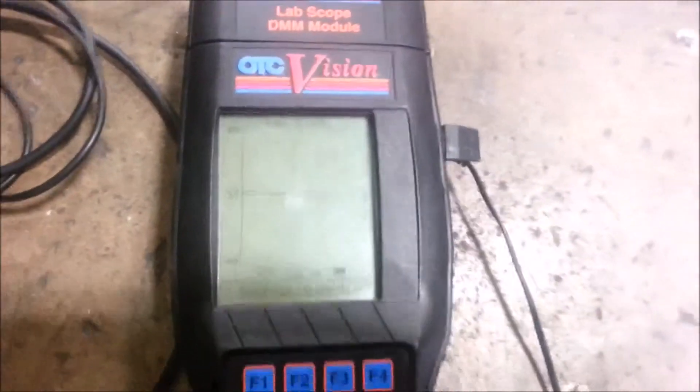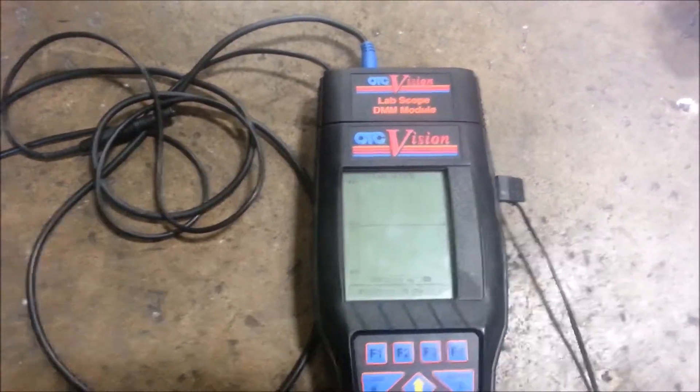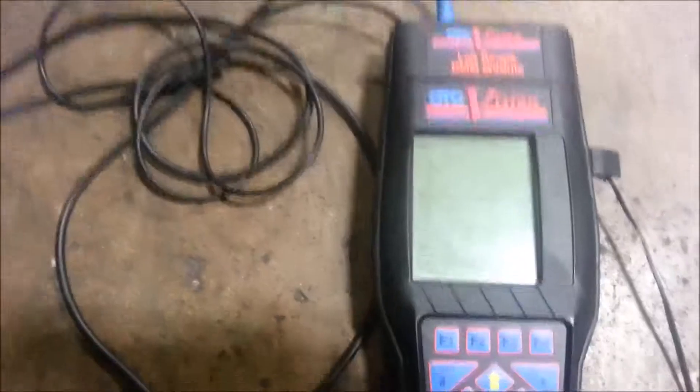But as you can see, there are no flat spots — the wavelength is actually clean. If you happen to have one of these scopes in your shop, they're right around five thousand dollars, but it makes it a lot easier to diagnose a possible issue with the ABS. Again, this is Robert from Jones Tech — have a good day.